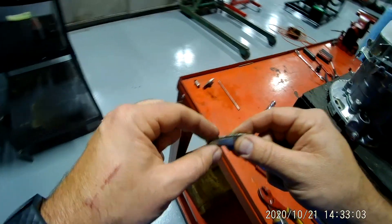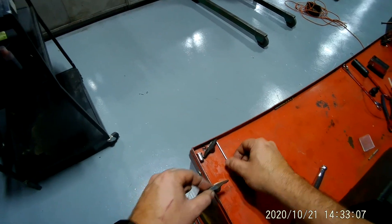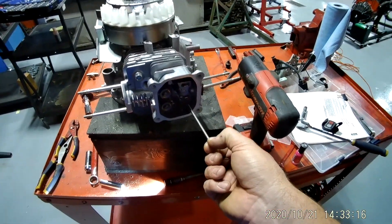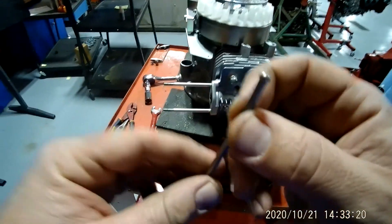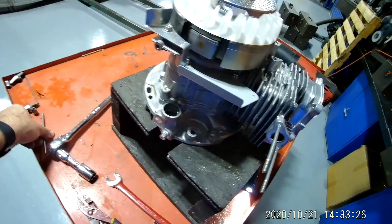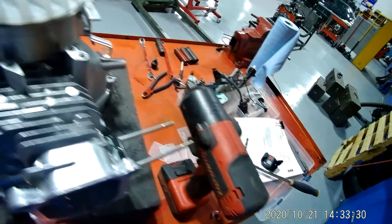Now I'm taking that top one off, and for right now I'm going to put my bottom one right here. I'm going to take this push rod out. When you're looking at this you ought to inspect it — if this thing is bent, cracked, or deformed, that means you should replace it. Now our rockers are off.